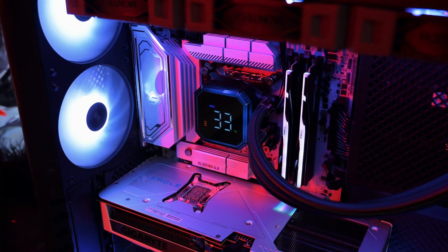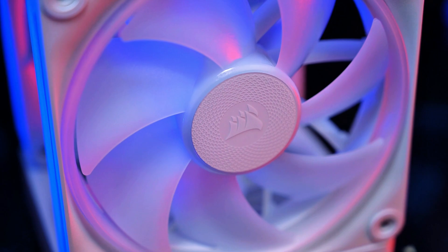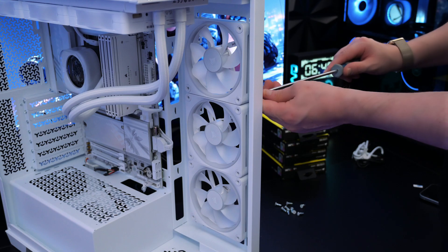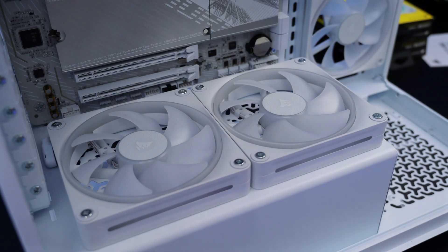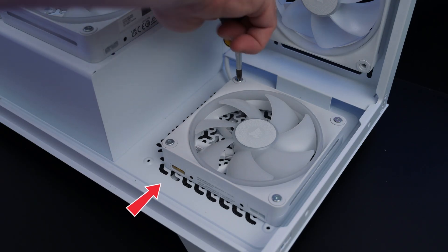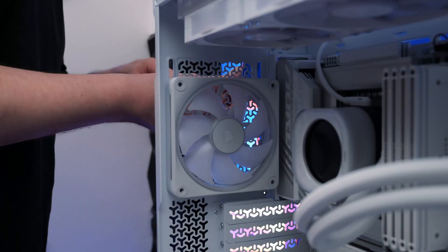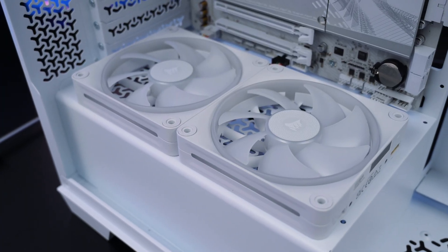I've recently made a more in-depth guide on AIO mounting — check it out on my channel. Now let's add some serious airflow with these seven Corsair fans: four Corsair iCUE LX120s and three LX120R reverse fans. The reverse fans are perfect for intake on the bottom or side since they hide the back of the fan hub and cables. I'm installing the three-pack of reverse fans at the side for intake and three LX120s at the bottom, though I'll probably reduce the RPM of the bottom fans. Each fan can be linked together with the connectors or cables, then linked back to the included fan hub which controls fan speed and LED lighting. Download Corsair iCUE software after the build is complete. Lastly I'll add a single fan at the rear for exhaust — this setup guarantees great airflow and awesome LED lighting effects, which I'll showcase at the end of the video.